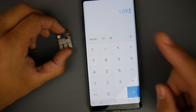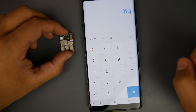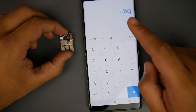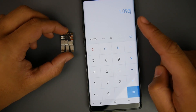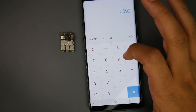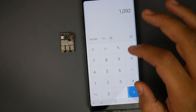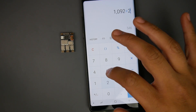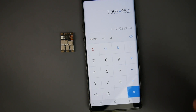This is pretty insane. Now if you wanted to see this on a 6S — how many amps that would mean for one minute — we take the 1092 watts and divide it by the 6S voltage of 25.2V. That gives us 1092 ÷ 25.2 = 43 amps for one minute without anything covering it.